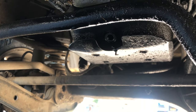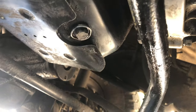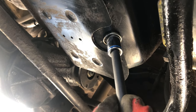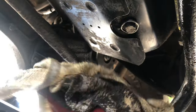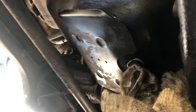As you can see, it's come to a very slow trickle, so I'll go ahead and hand tighten the drain plug first, then once I can't tighten it any more I'll go over it with the 14 millimeter socket. Don't tighten it too much — just enough. Don't over-tighten it because you'll have trouble removing it during your next maintenance. Another thing I did was grab an old shop towel and clean up around the drain plug area so I can tell if there's an oil leak somewhere. If there is a leak, I'll have a clear idea of where it's coming from. Looks clean at the bottom — just a little tip.